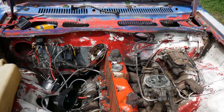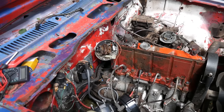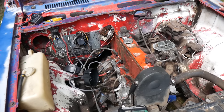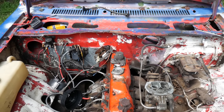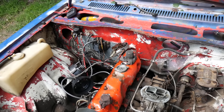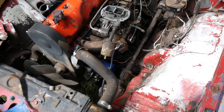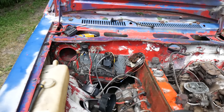The GM HEIs will run all the way down to 6 volts — they should fire on 6 — but you really don't want to see below 9 volts consistently. 9 is kind of borderline for myself. You want 12 to 14 on them if you want good high performance. We'll see if this $6 Walmart battery cable will give us more of a ground. We'll test it right now.